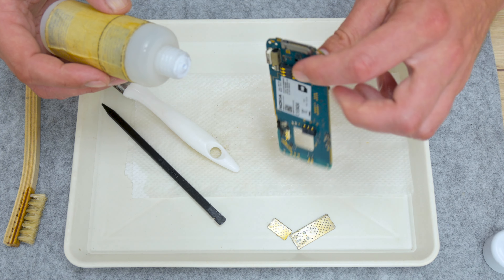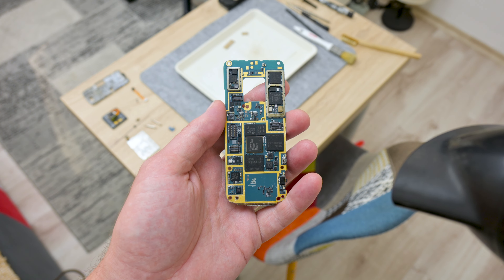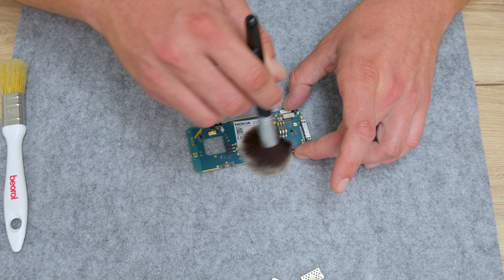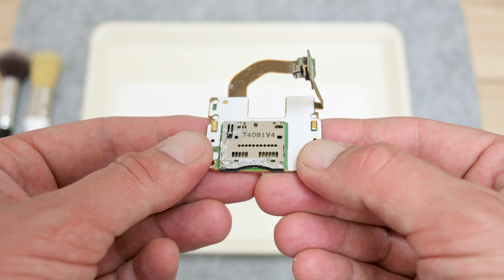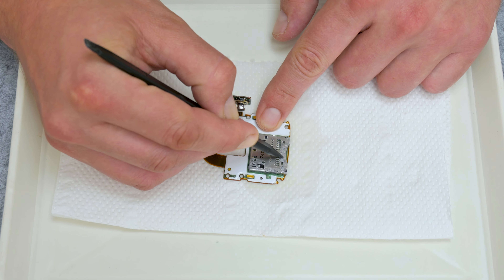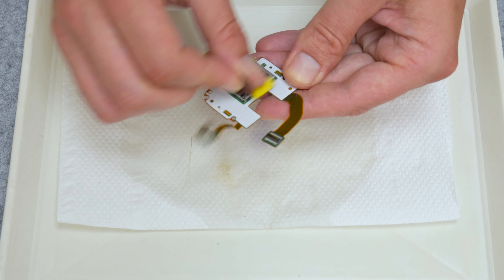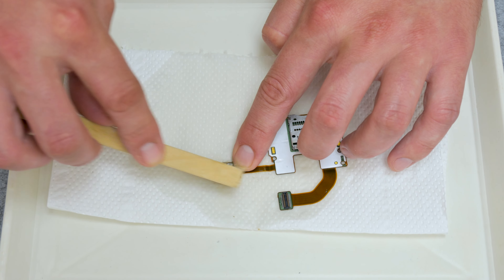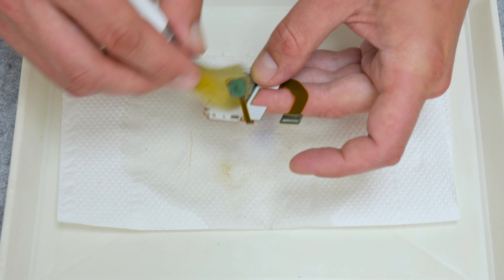If I need some additional drying, I can use just a hair dryer — it's simple, nothing special, and easy to work with. The part with the joystick, card reader, and keyboard is pretty dirty and corroded. I start with basic cleaning first to remove most of the dust and dirt, and then I used very fine sandpaper to remove the remaining corrosion. After removing the corrosion, I re-cleaned the whole part again using brushes and isopropyl alcohol.